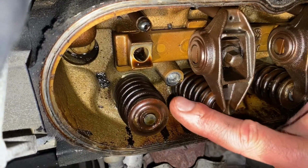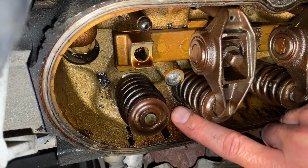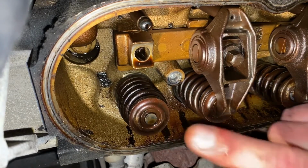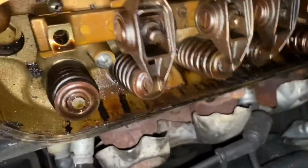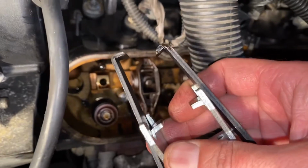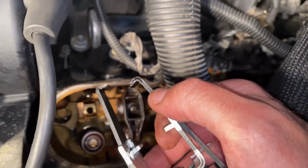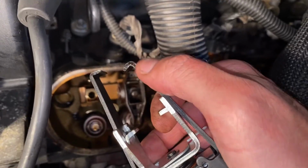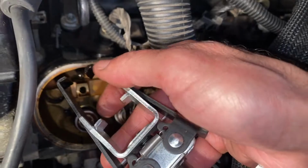You'll notice on the right side of this spring, it's higher right down in here where it goes lower on that side, which is why on the compressor, pull back a little bit so you can see it, the compressor has this side longer, that side shorter, so it can fit around that. So let's slide it on and start compressing it.